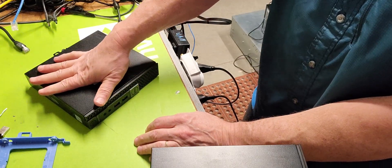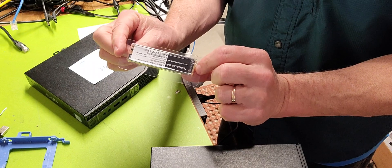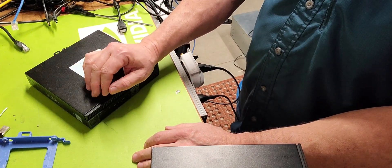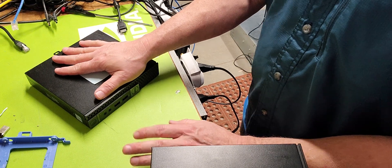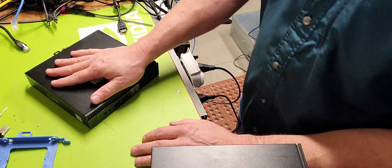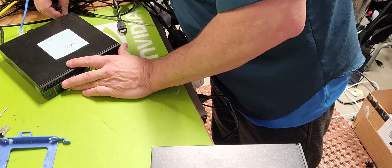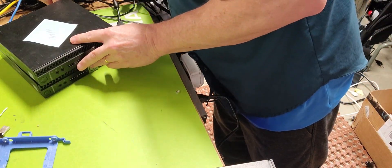Instead of using the 128GB M.2 standard cards we have onboard — which look something like this — you could put in a 1TB M.2 drive for ultimate high-performance capacity and run some of your local VMs on that. Then you use the SATA disk I just installed as your second-tier performance for test and dev. Then you use NFS for what you'd call enterprise VM sharing — giving you the ability to move VMs from one node to the next.